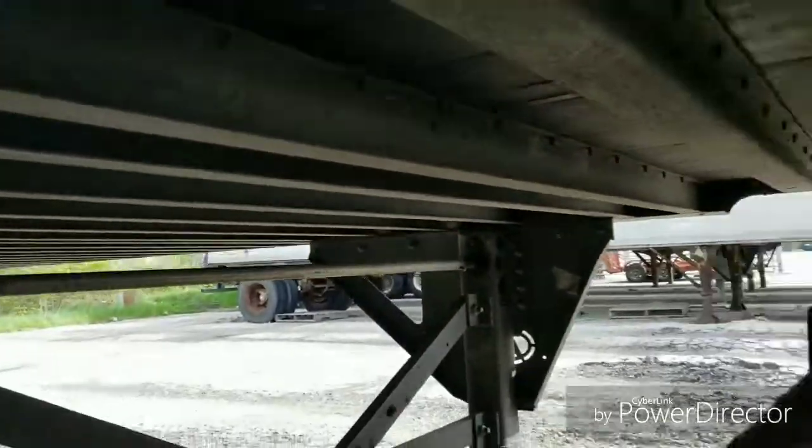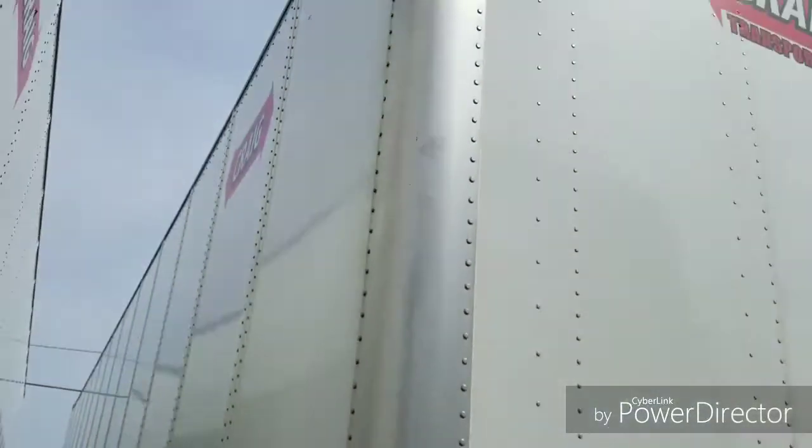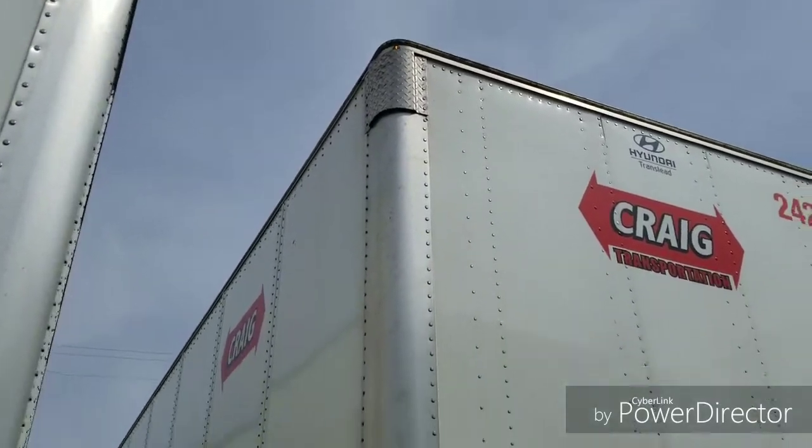This is just a quick mid-trip inspection — just want to make sure the trailer is safe to go down the road. Something I probably should have mentioned: when you're in the back of the trailer and looking underneath at your pins, you want to listen for audible air leaks. And if you can visualize your brake pads, you want to make sure they're intact and have enough meat on them to meet DOT specs. I'm not crawling underneath on my back to look at everything, but this is just a quick mid-trip. Just a little disclaimer — I am not a CDL instructor, nor do I intend to be, but these are just things that I look for.